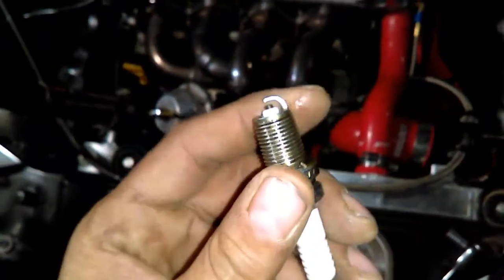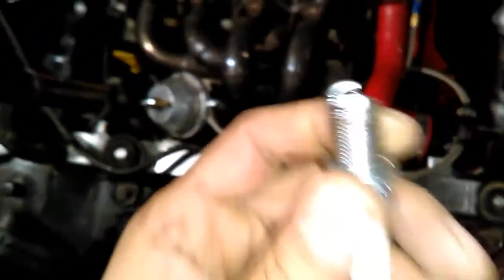I really like the white hood. I'll be getting a carbon fiber hood for it as well. The catch can - we took it off because it kept blowing the freaking dipstick clear out. You can see the oil blew everywhere, out the bottom, all out of the top. We got rid of that and haven't had that problem ever since. Here are the brand new spark plugs we're gonna put in - these are from when I did the compression test, they're brand new.